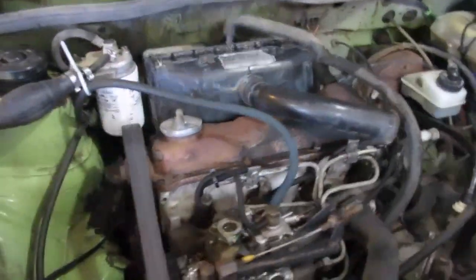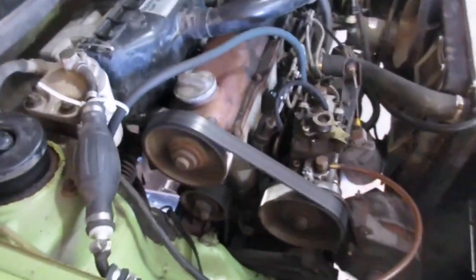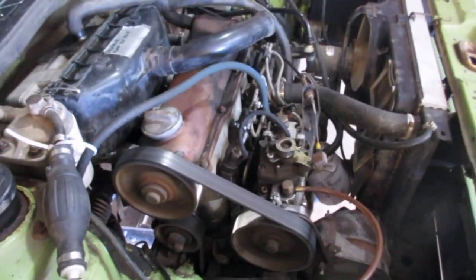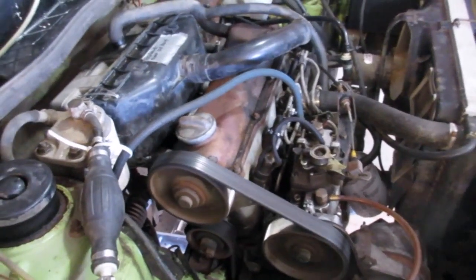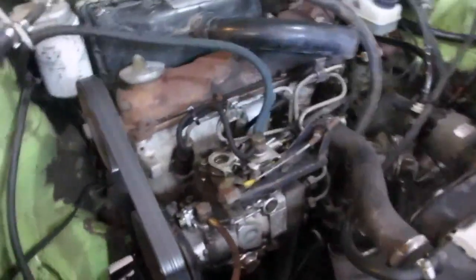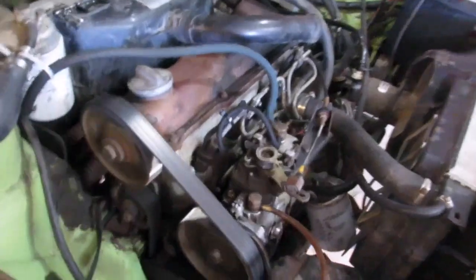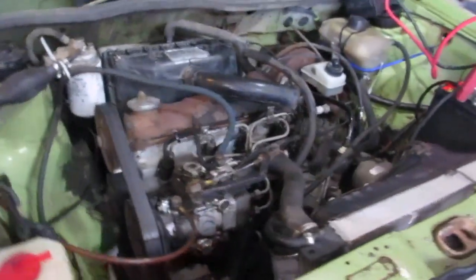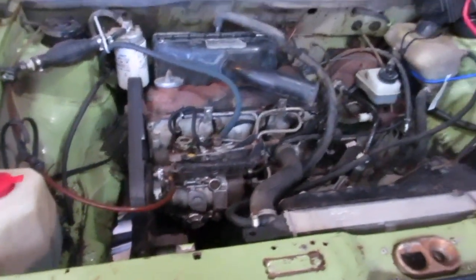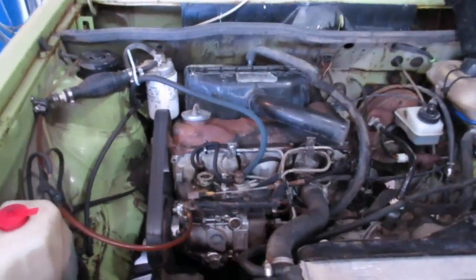This thing kind of runs a little rough too — unless that's just how they are. I don't know if the injection pump timing is a bit off or what. I don't have the tools to do that but I'm interested in purchasing them, so that's something I'll have to look into. I'm also wondering if it doesn't have a bad injector. When you fire it up it smokes for about 30 seconds to a minute and then it seems to clear itself off.